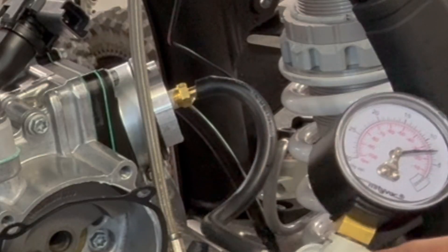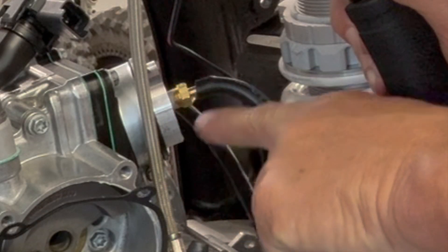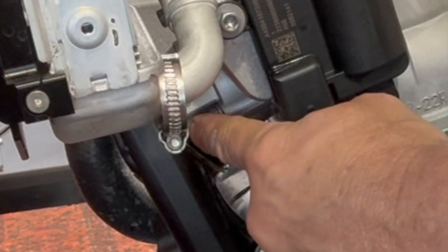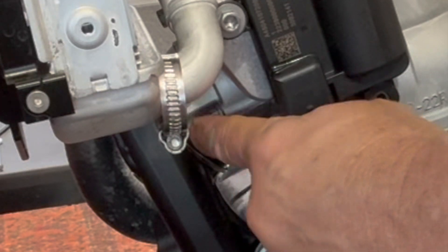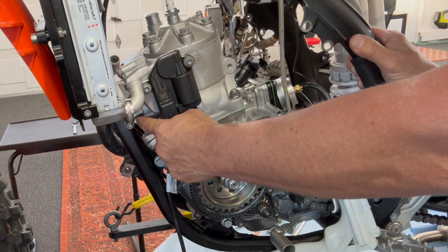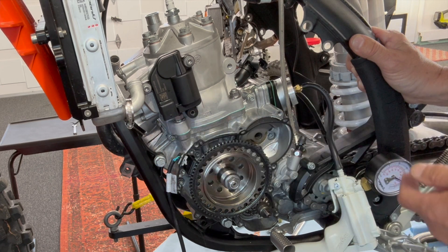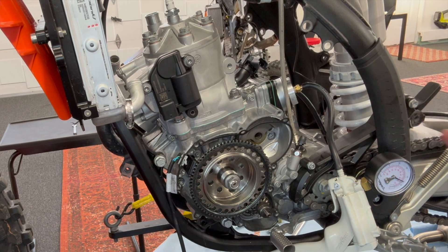You can probably get one of these vacuum kits off Amazon. It's a two-inch plug with a vacuum hole in it — a two-inch rubberized expandable freeze plug that you get at the auto parts store. You do have to sand down the rubber just a little bit for it to fit into the exhaust port. Tighten that down and the thing's sealed up, and hopefully you're making some more snap.